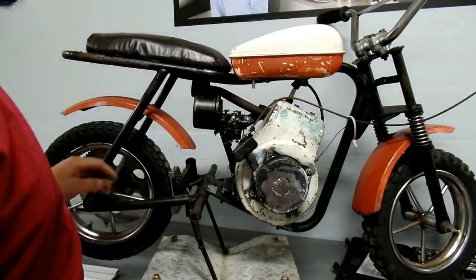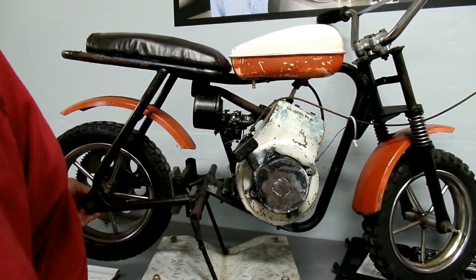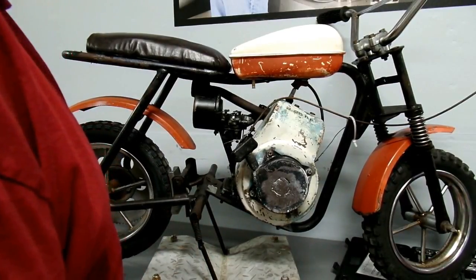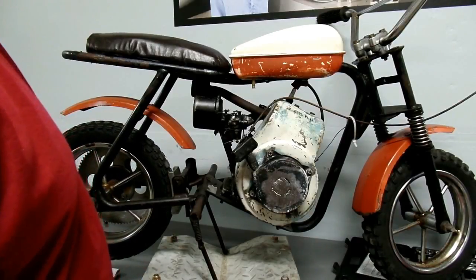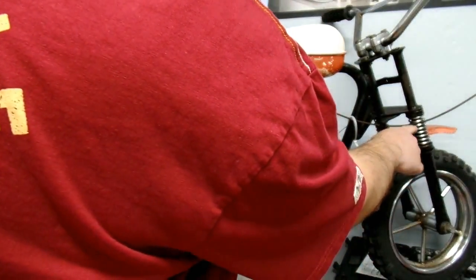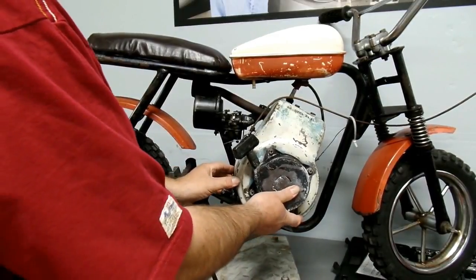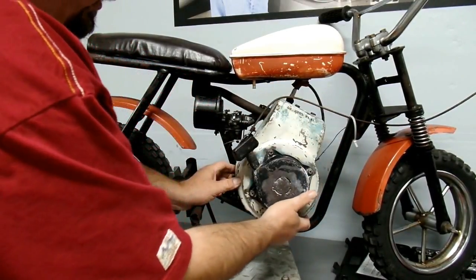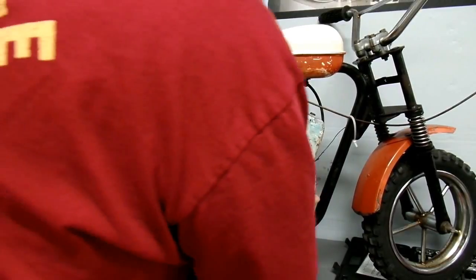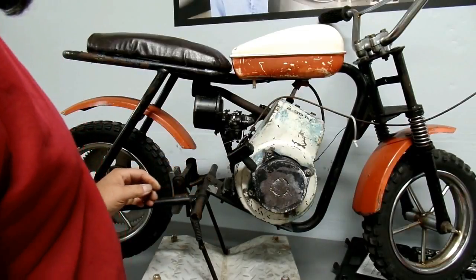For unknowns, you basically have the condition of your engine, bearings, and all that stuff — you really have to test it as you go along. The front fork has no compression left in it, so I think probably it's rusted up in there. The motor has an issue where it's missing a couple of bolts and this cover is not really attached very well, so we need to get in there and see what's what.